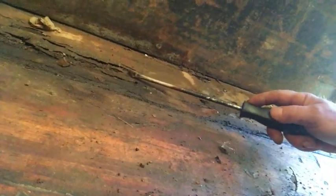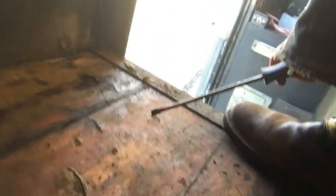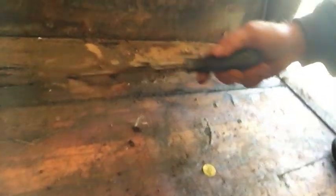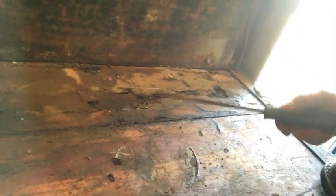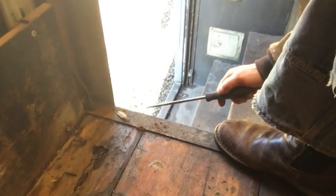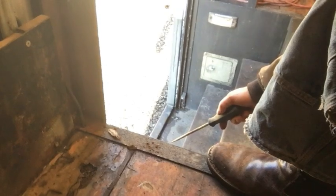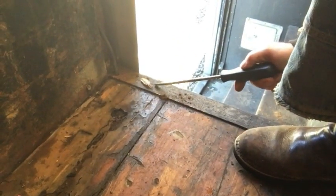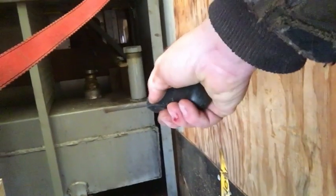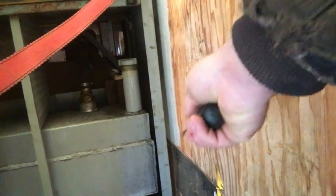I have those glued together and in some clamps, so that should be dry today. I want to go ahead and take this part up. I know there's a cross member in here because there's a screw underneath this and a screw underneath this. I have to take this panel up in pieces, and the panel I'm building I have to cut in two where there's a structural rib that runs across the floor, so I can get it underneath this piece of angle iron. This is where the steps are to come in the man door — a piece of angle iron — so I have to feed the board underneath this piece of angle iron. I could take it off, but I'd have to remove that fuel tank because there are screws back behind this panel, so I've decided to leave this panel attached.